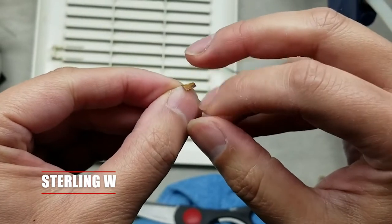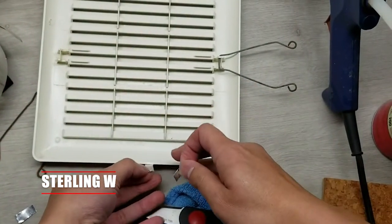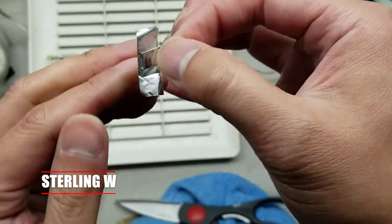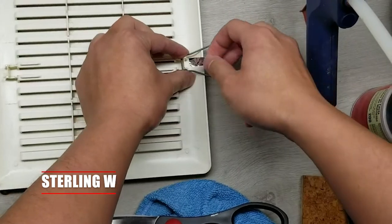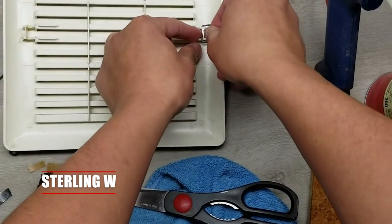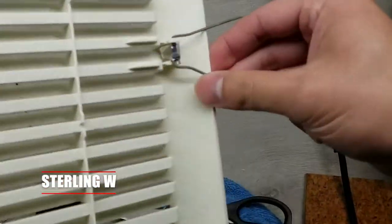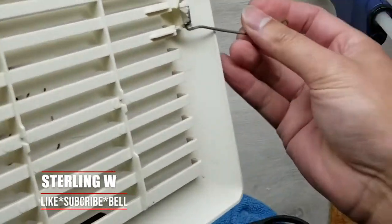Using this, I'm basically putting some foil tape upon itself so it doesn't get gummy where it goes on the spring. These are very small little pieces — probably a quarter inch. It depends on your own grill, if it's wider or shorter or whatever. I'm basically putting the adhesive sticky side onto itself so that it won't stick onto that spring latch. I'm putting that right over it — this is just to hold that latch in place where it originally was, so it won't move. That's the whole point. The adhesive on this aluminum foil tape is very strong, so once you place it on, it's pretty much going to stay there. It still moves, as you can see, because one side of the foil tape is covered by the other adhesive.